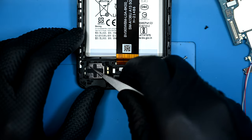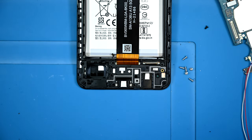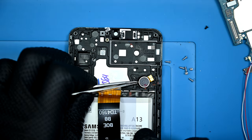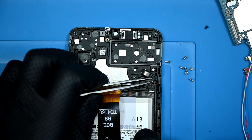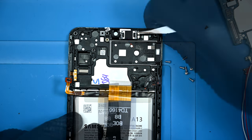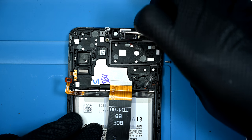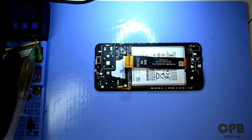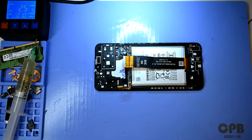It's time to start taking out the small components to transfer to the new frame, starting with the main loudspeaker. Back to the top — Samsung thought ahead and every component has a dedicated pry point. I'll get this old coin-style vibration motor pulled out from the notch on the left. The ear speaker has a pry point to the right of the top gold contact on the right side.